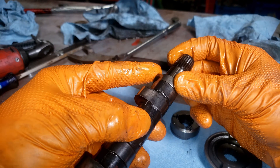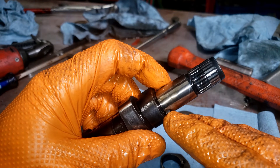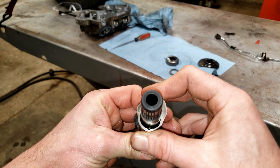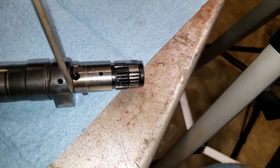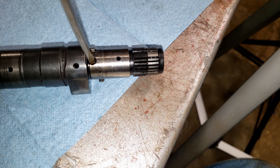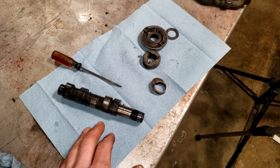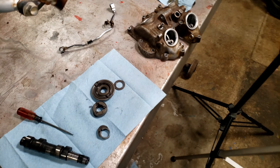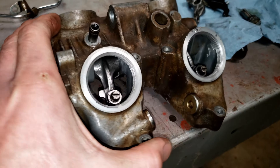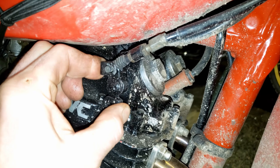This little part here is what gets worn out. It's very hard to see any actual visual wear, but with all that hammering all the time, it's definitely going to wear the pin and this piece out. Since this is a pretty failure-prone system, it's common for guys to get rid of it altogether and then weld up the oil hole so you don't have oil pressure bleeding out. Another good option is to just replace the entire camshaft — I looked it up, it's only $175 — but you would want to replace all four rockers too at the same time. If it were my engine, I would get rid of it and put a manual decompression. You could actually machine this out; the casting is still there for the old-style manual lever decompression, and even the rocker has the little pad on there for that. There's the one on the XL — much more reliable.